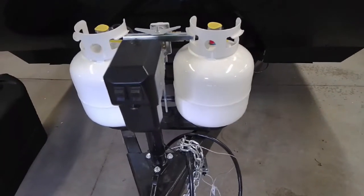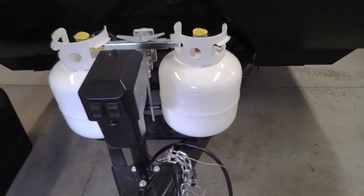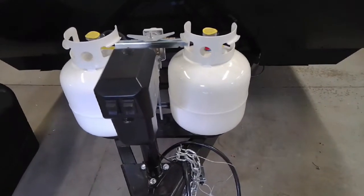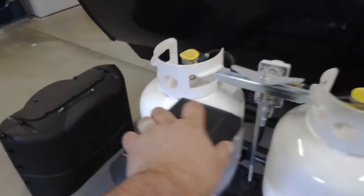You do have a battery disconnect switch up here. Switch that switch and it'll kill the power from the battery to the camper so the camper doesn't drain your battery dead. After about three days, your battery's going to die all by itself — you've got stuff that's hardwired to the coach that just drains: the radio, the carbon monoxide detector, LP detector — all that stuff has a draw on the battery, so eventually it'll just drain your battery dead. That's why you want to disconnect.